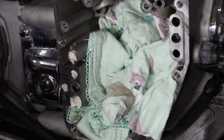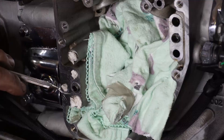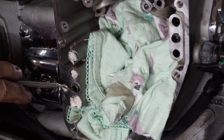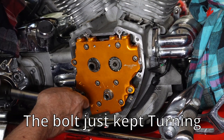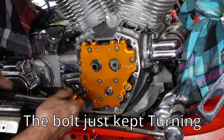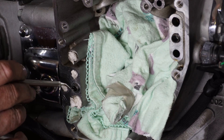When we started working on our plate yesterday, we had it in and mounted and we started torquing the bolts all around in the sequence that you're supposed to. When we got to this one with the boss in it down here, it just stripped at 90 to 100 inch pounds where they're supposed to be. I tried to put a little longer bolt in it — sometimes that will alleviate the problem — but the longer bolt stripped as well.